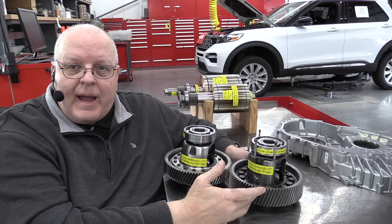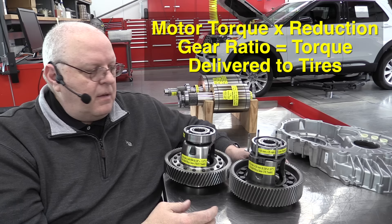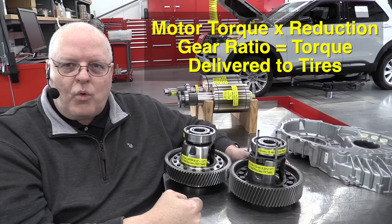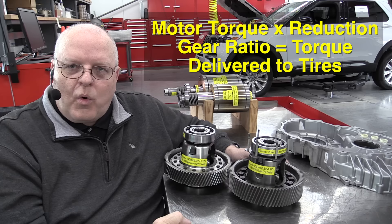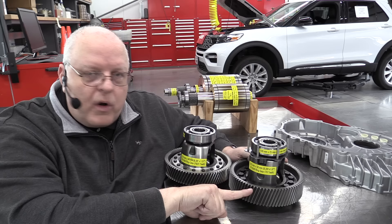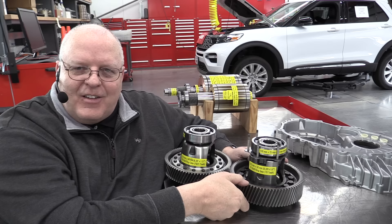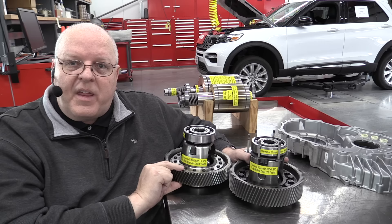Several people asked why the ring gear and SKF bearings on these differentials are so big — it's because of torque multiplication from gear reduction. If we have an electric motor that produces all of that torque and then run it through gear reduction, the torque delivered to the axle shafts, the CV shafts, and the tires is basically your motor torque multiplied by the gear reduction ratio. So the bearings must be large to handle that amount of torque. The gears must be large because all of that torque is transferred one tooth at a time. The front electric motor on the Tesla Model S isn't as powerful as the rear motor, so we can get away with a slightly thinner ring gear.